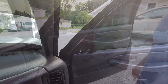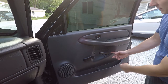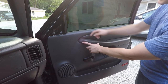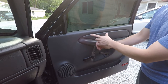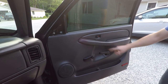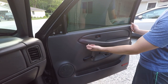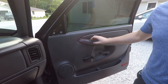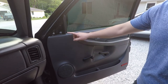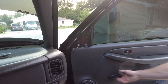If you have electronic accessories, you're going to have to take your door panel off. To remove the door panel, pop this out — it has a spring tab here and an arm on this side. Then remove the screw on the front, pop that out, take the connectors off the back, and there's one screw that goes right up underneath here and one that goes all the way down at the front left corner. Then you can pull the trim up and out — make sure you disconnect the connectors and your speaker wires. Once you have the electronic wire unplugged from the accessories that run up to the mirror, then you can remove the three nuts and swap the mirror out. Make sure you have another person on the other side to hold the mirror, or you can lower the window.